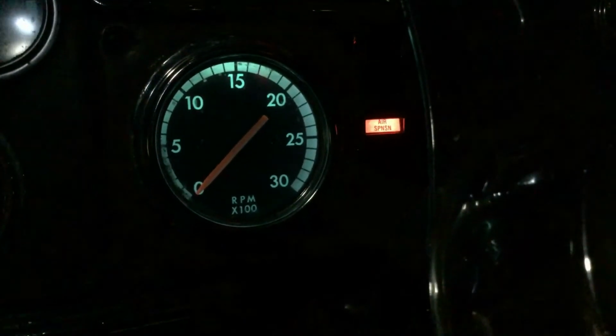Right there's your power locks. Power windows that run by air, oddly enough. Your trailer and tractor air brakes. This thing has a double jake. This switch turns on, or jakes, 2 of the cylinders. This one does 4, because it's an inline 6. There's your 5th wheel slide. And the axle differential basically makes all the rear axles drive. Air suspension, which is on right now. There's a light that says that it's on. The air suspension light is on.